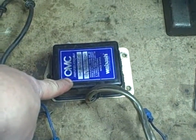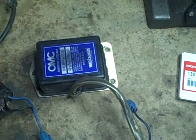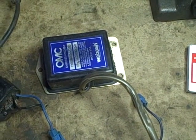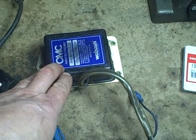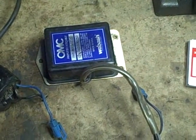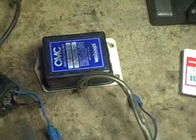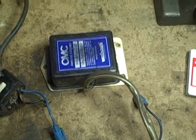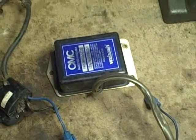From what I've read online, one of the things that caused frequent failure of this module would be bad connections to the battery. The other problem is it didn't want to fire if the battery voltage was too low. You can imagine if you ran your battery down while out on the lake — it wasn't like you would get weak spark. You would get no spark. So that was not good.